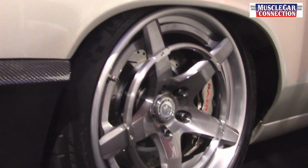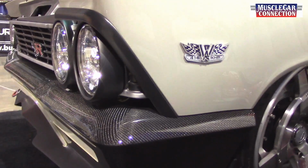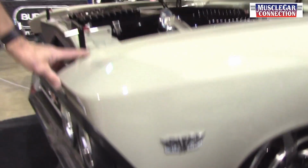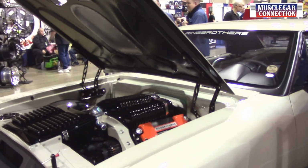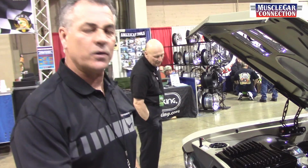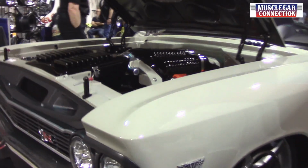Let me ask you, as I'm not familiar, what's the process for doing the bumper? Do you take the stock bumper and make a mold to get a general idea? Well, we do on some, but this one we just started over. It's just easier to build it. So just from scratch, and you just mock it up. How do you mock it initially? Do you do it out of cardboard? This was very quickly spot welded up pieces, and then mudded over. You can use cardboard, paper, anything. It's only to get a plug.